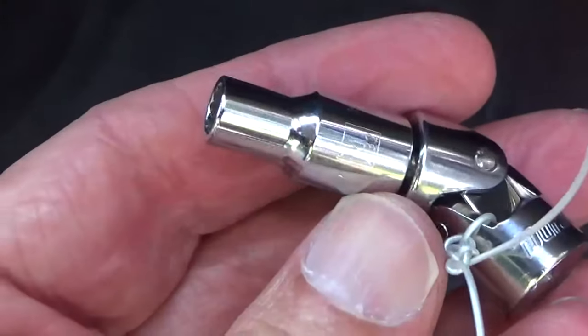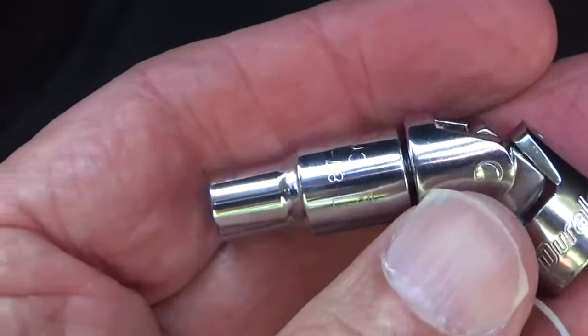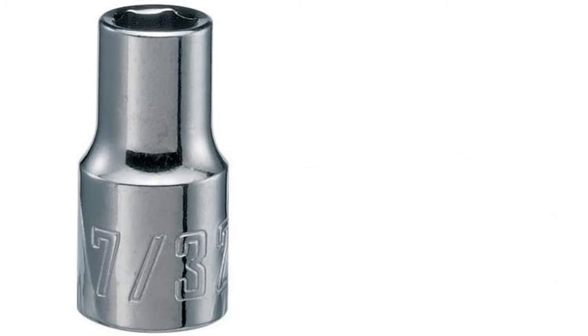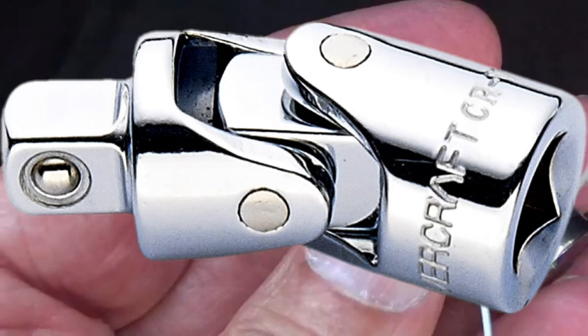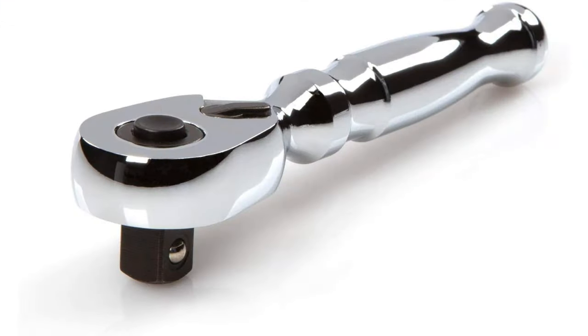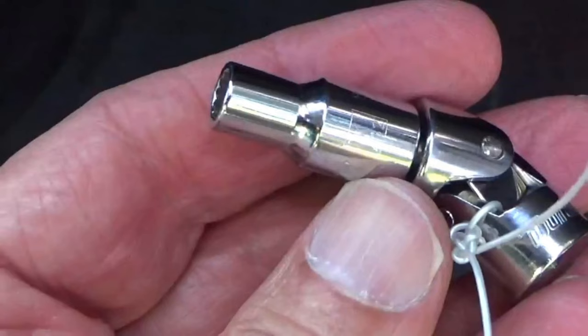This is what I'm using to take the screws out — just a little socket with an elbow. You need a 7/32-inch socket to remove this screw; a 5.5mm socket will probably work also, they're very close to each other. To help work in the tight space, I bought a universal joint socket adapter at AutoZone for about four dollars. That gave me a better angle on the screw as well as good leverage. If you have a short-handle socket wrench, that should work well also.